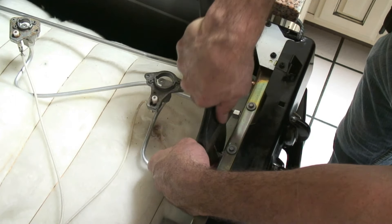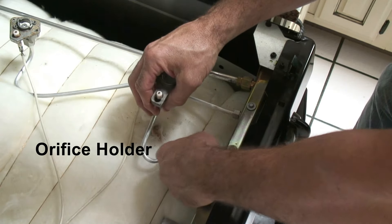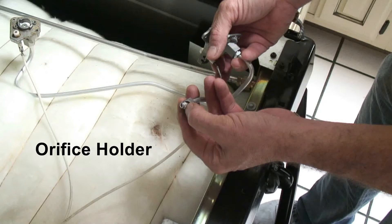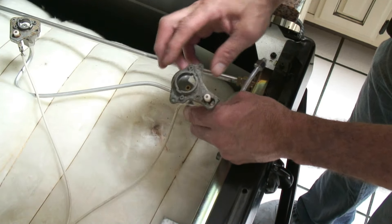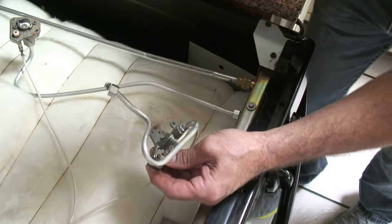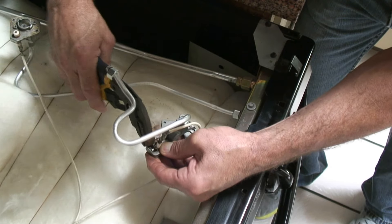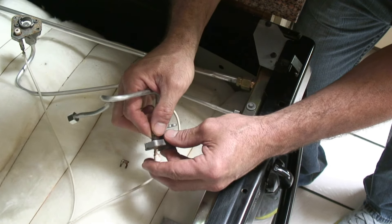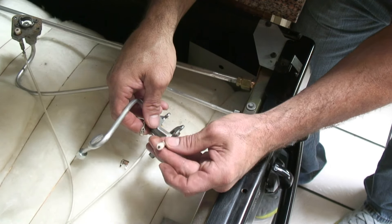If you want to replace this burner, you just unscrew it — I use a crescent wrench to do that. You have a compression fitting on there, so you don't need any tape to put it back on. Right here you can see your igniter. You flip it upside down and there's just a retaining clip that holds it in place. Sometimes it's a little stiff to get out, so you'll need some pliers. You pull that out, slip this up, and take the clip loose on the back. Now you can replace your igniter.